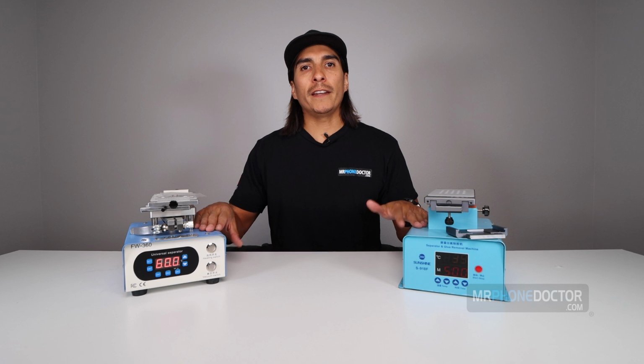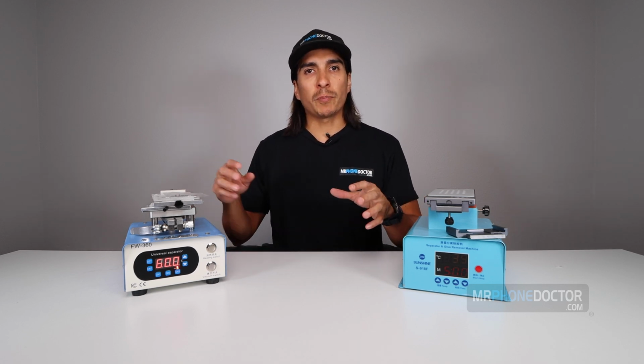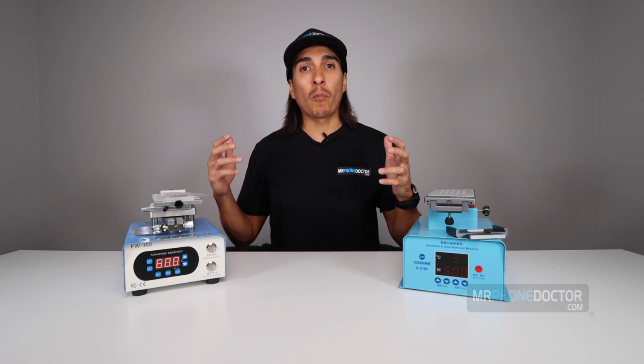Now there's a lot of you guys asking, why don't you freeze the S9s and above? We still have a very low success rate, so therefore I am not a fan of the freezer. We do like to use a freezer if we do get some S8, S8 Pluses in bulk. We'll definitely throw those in the freezer. But as far as everything going forward, this is going to be the way it is. You're going to have to learn the skill of how to separate the glass from the displays manually. And using these tools here, it just makes it a lot more seamless.